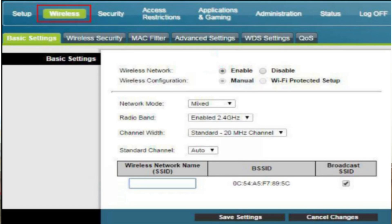How to change Rogers Wi-Fi to 2.4 GHz. To change your Rogers Wi-Fi network to 2.4 GHz, you'll need to access your modem settings through a web browser. First, make sure you're connected to your Rogers network. Open a browser and type 192.168.0.1 in the address bar, depending on your modem model.